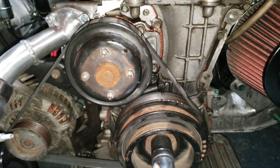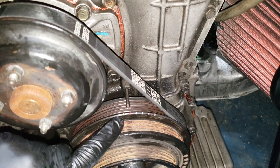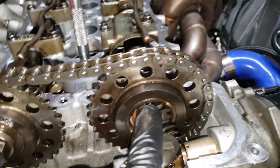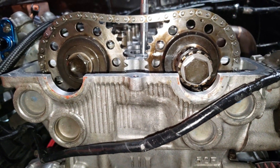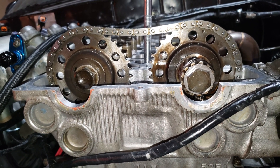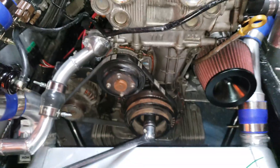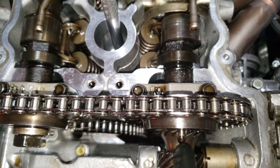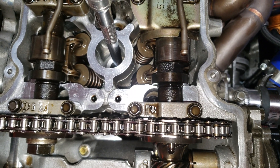So on top of the other videos, put your timing mark on that second notch on your harmonic balancer — that's top dead center. This dowel, not that dot, but this dowel should be at the 12 o'clock position. I had kind of an issue verifying because these engines sit off-centered in the engine bay, especially if you have a radiator in the way, like I don't with my semi V-mount setup. I found this pin and lined it up with the center of the camshaft — that was the easiest way to get it at 12 o'clock.